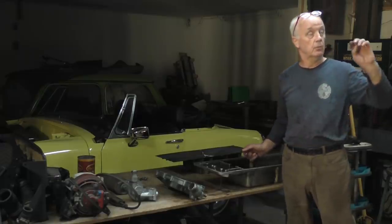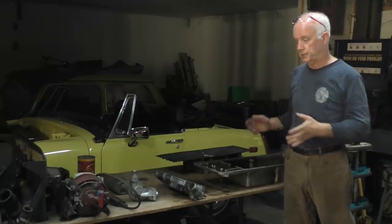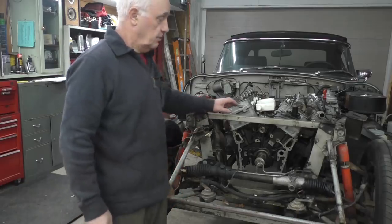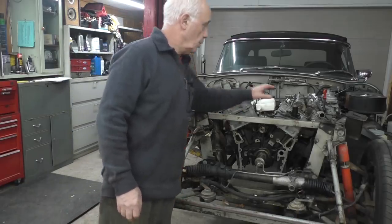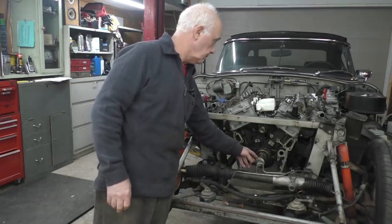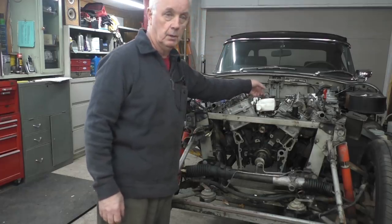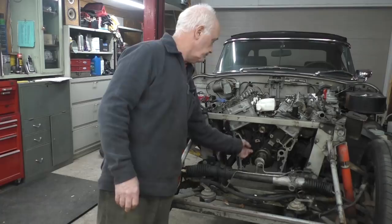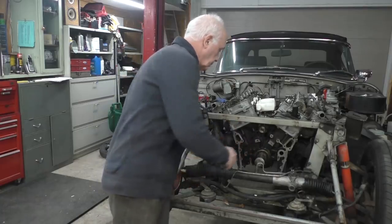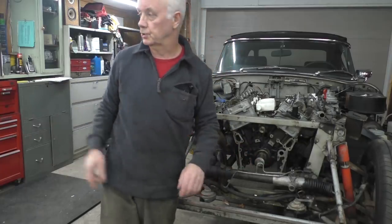Anyway, my next stage now is I have to take off the pulley and do all the timing chain. So that's a different section again now that we're doing. On the front of the engine, I've removed all the sprockets on the camshafts and the sprocket on the crankshaft on the bottom. There's an intermediate shaft here that drives the distributor. Anyway, I took all that off and all the chain off. I removed the oil pump that sits on the crankshaft, and I've got all these pieces on the bench, so I'll show you them.